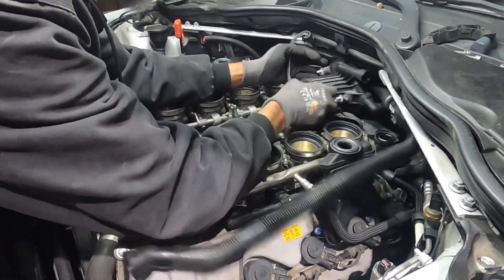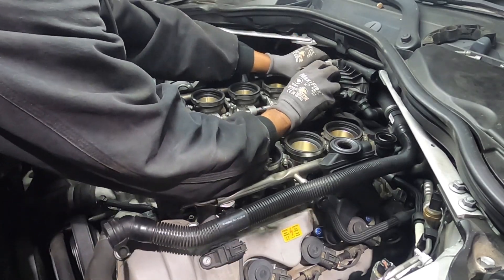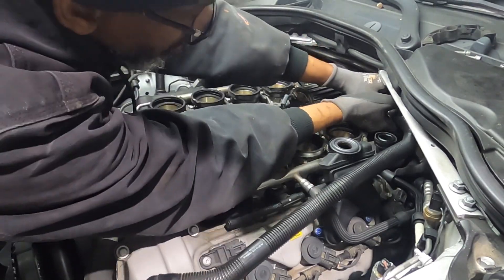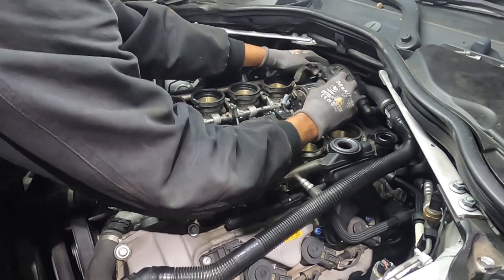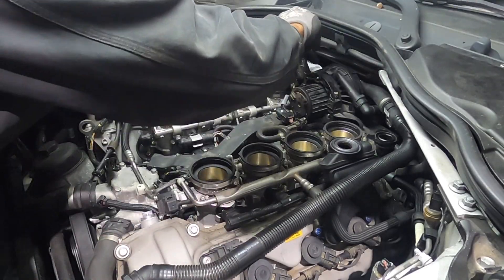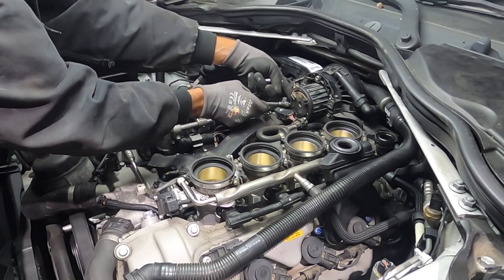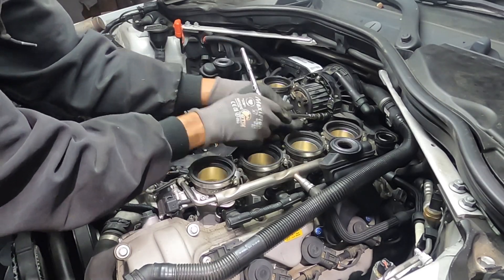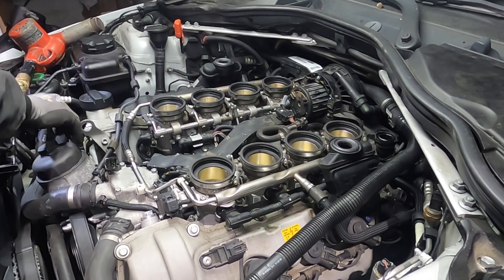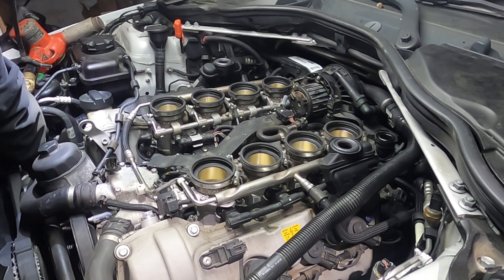Afterwards I realized I could work around it. I had to clock it correctly for it to fit into the spot - I just roll it there because I didn't realize it was flexible on the connection point, so just helping you out. I'm showing you some missteps - not really missteps, more like unnecessary steps - so you can save time, and time is money. There's also an electrical connection on the secondary air pump tube right there. There are so many sensors on this engine, and the way they assemble it is quite unique. This M3 engine is a special project - I can tell just by how it's put together. Tightening up the secondary air pump, connecting all the wires associated with the actuators below that rigid electrical harness.